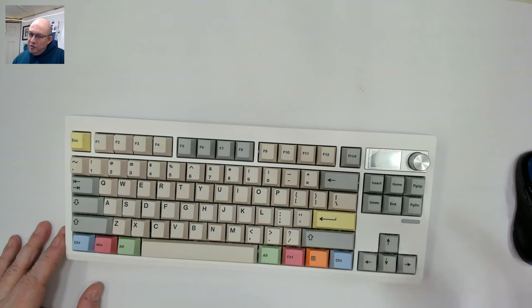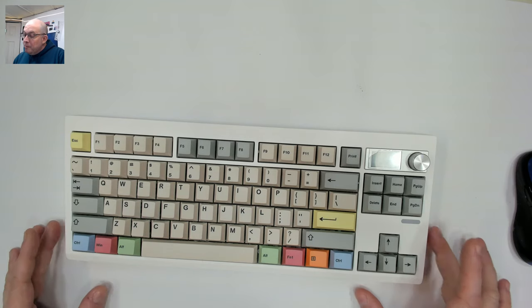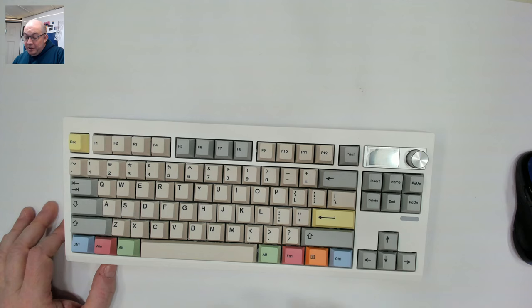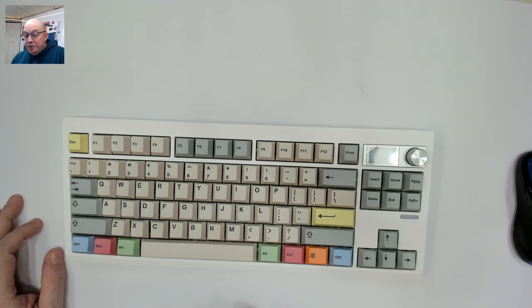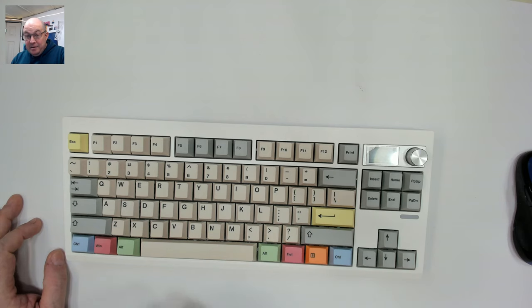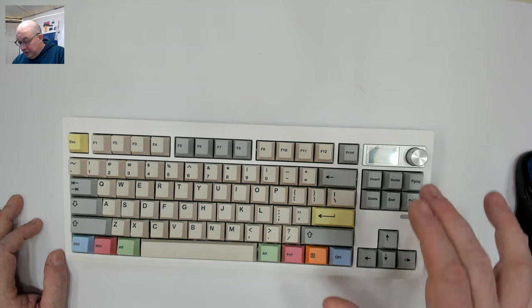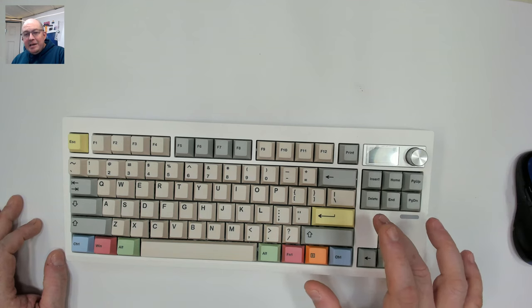I think that if they just got a better MCU, I wouldn't mind paying a little bit more if this was QMK Via. But that Via that they're building is limited. Some of the codes that they have just won't do anything because there is no QMK in the firmware. It's either their own implementation or it's a layer that's communicating with their already closed source firmware that they make, whatever's going on. So you have to go into certain sections, you go to the Any key, and when you select a key to map, go to Custom, I believe, or Special, and then you select the Any key, then there's a drop down.